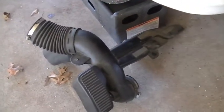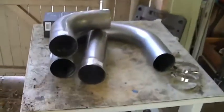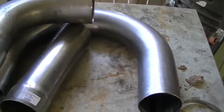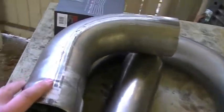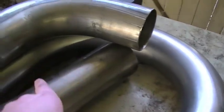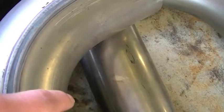There's the old intake tube right there with all its little silencers and whatever else are on there. Here's the parts to fabricate the new one. This is all 3.5-inch — got a straight piece and two mandrel bent pieces: a U-bend and a 90-degree bend. This large U-bend has a 7-inch radius. This tighter 90-degree bend — it doesn't mention what the radius is, but it's far less than 7 inches. I would say it's probably about 4 inches.